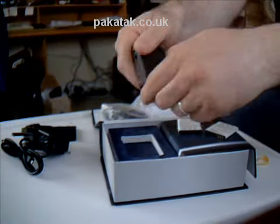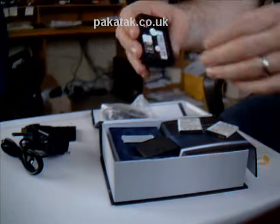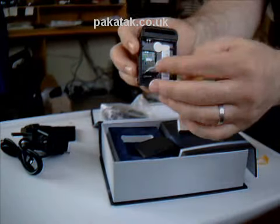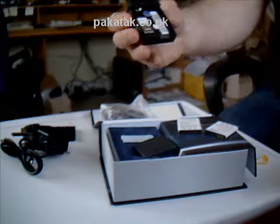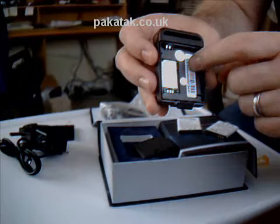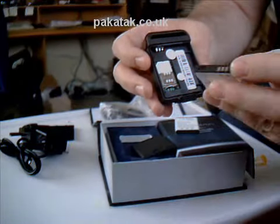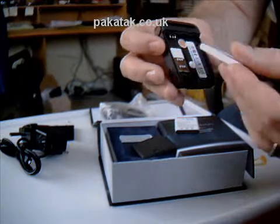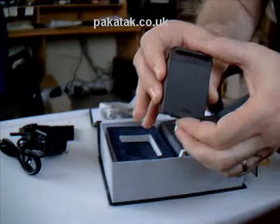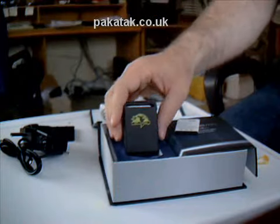The fitting of the battery is very straightforward. Just pop the back off the unit. I've actually already put a SIM in there — it's just a standard SIM tray. Pop that in and the SIM is fitted, simple as that. It's a standard mobile telephone-style SIM fitting. You've also got your serial number on there. For the battery, just match your terminals on the battery with the terminals on the tracker unit, pop that into place, refit the back, snap it shut, and that's the tracker up and running. Operationally it's pretty much as simple as that.